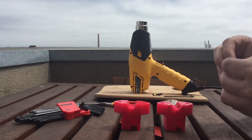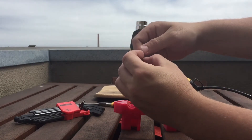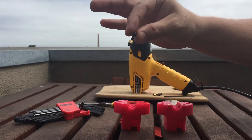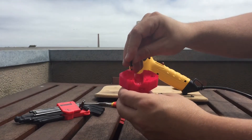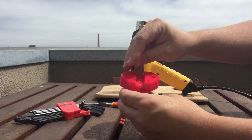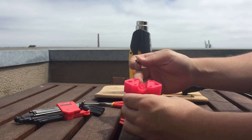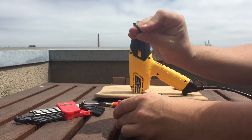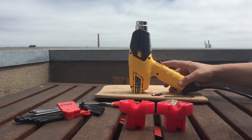You're going to want to take your knurled insert and thread it onto the M3x20 bolt with a couple millimeters of overlap. I found that when you insert the warmed-up brass knurled inserts into the plastic, sometimes the plastic melts down a little bit and can gum up things underneath, so a couple millimeters extra on the bolt will help keep that clear.